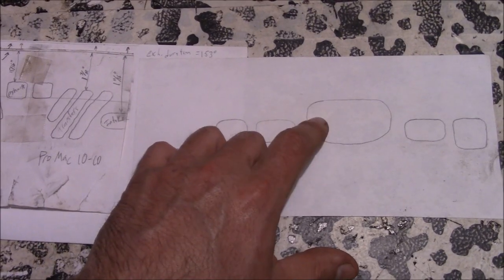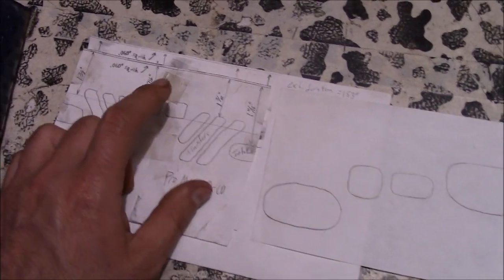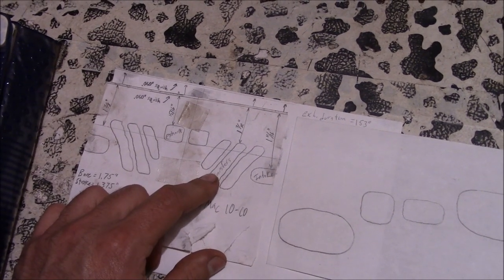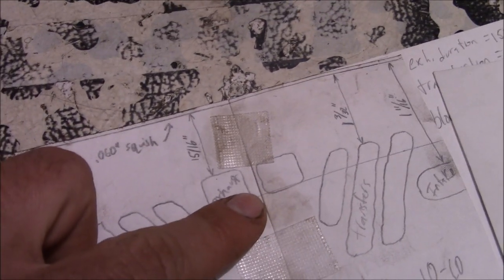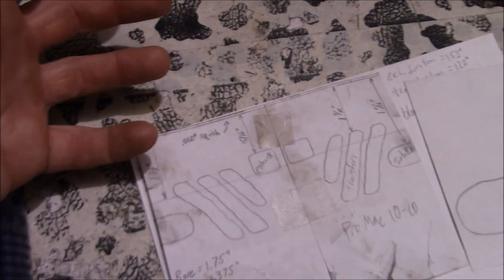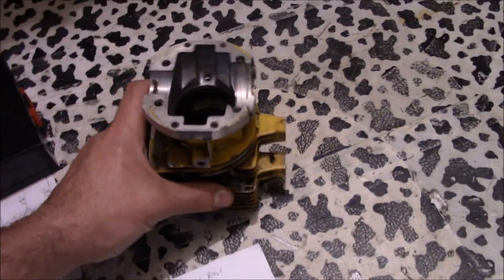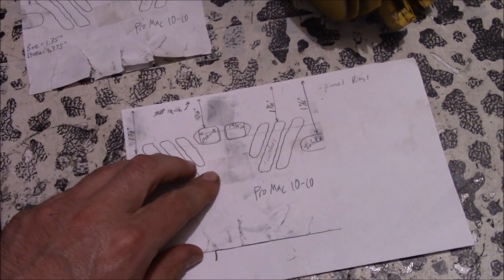So as much as I want to change things up and go with the normal style of expansion chamber two-stroke porting, we're probably going to hang pretty close to stock on this because these saws ran pretty good from the factory, so I don't want to change it too much. But there is one glaring problem. That bridge in the center of the exhaust port. That's just blocking flow, and that's blocking horsepower. So we're going to port this thing out because you always need more power. And those trees ain't gonna turn themselves into sawdust by themselves.